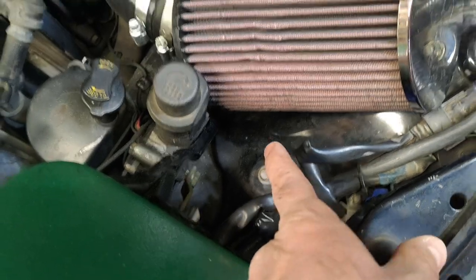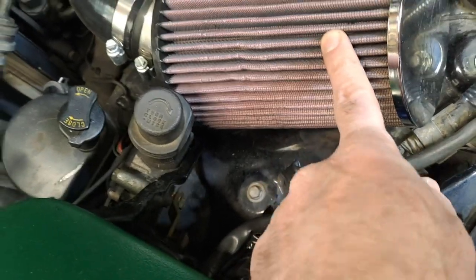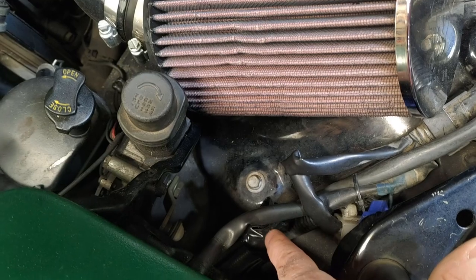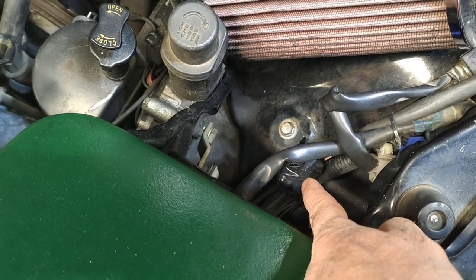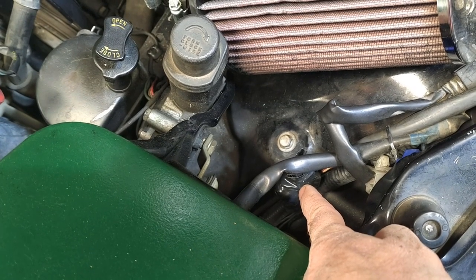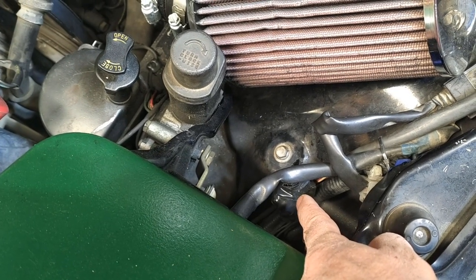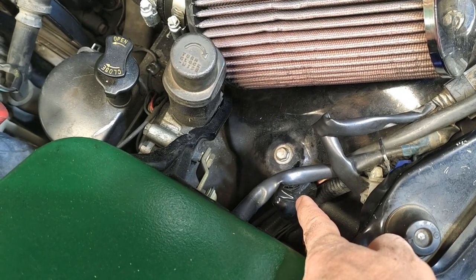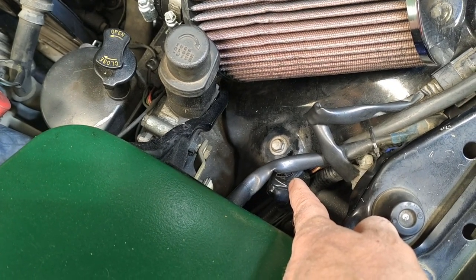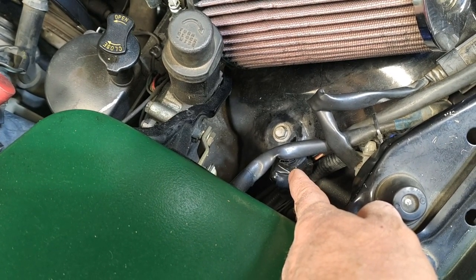Around about here is a good place for it. We've got an extra bolt here that was originally for the air box, which has been replaced by this cone filter. And conveniently, this little plug wrapped in electrical tape is where the MAP sensor used to plug in. That is where we are taking back our intake air temps, and we can use this for boost control.